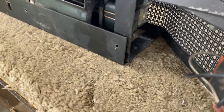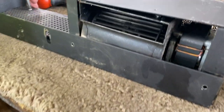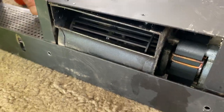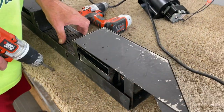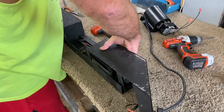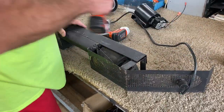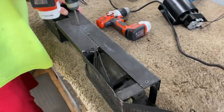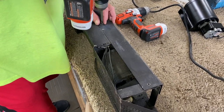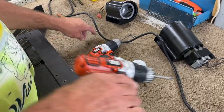The original blower isn't terribly bad. Some of the initial problems in the early model blowers was that most of them were using brass sleeve bearings — hard to tell until we actually take it out. The bigger problems you see are the use of plastic wheels in the original blowers. A lot of times these are inserted on the shaft and glued on, so they get loose. You get ember intrusion, ash intrusion. The operating temperatures these things run at are very high, so the plastic wheels don't hold up as well as we'd like.